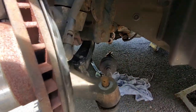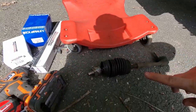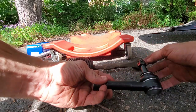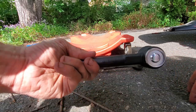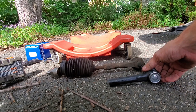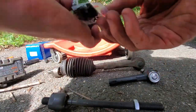Now since we got that out, all we have to do is bang this out. I'll do a comparison right now, then we'll measure the length and put the new one in. Loosey-goosey — not so loose for the outer. The new outer comes with the new castle nut. You have to be aware of the lengths because each manufacturer might have a slightly different length on the outer. As you can see, this outer is a little bit longer than the OEM one.